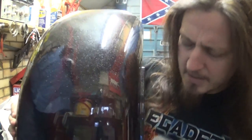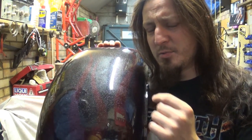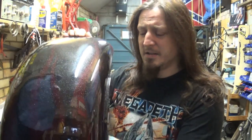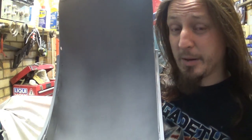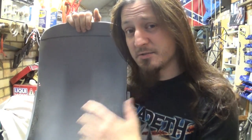I've been doing some work on it off camera, and it surprises me that whoever was doing that paint job, for that quality bike, that level of art, they cut corners on the inside. Right at the moment I've cleaned it all up and primed it, and that's going to be all painted black — heavy 2K black — so it doesn't rust through anything.